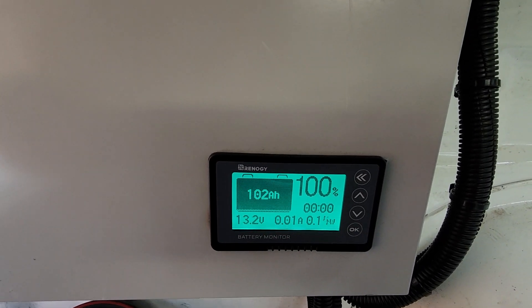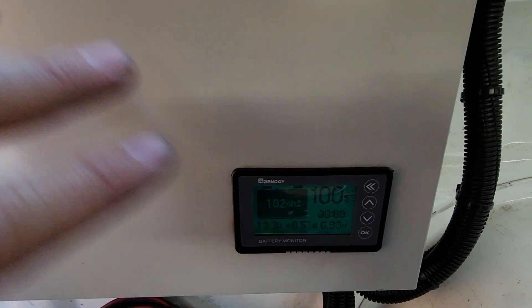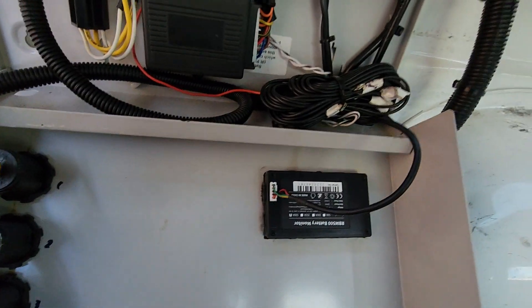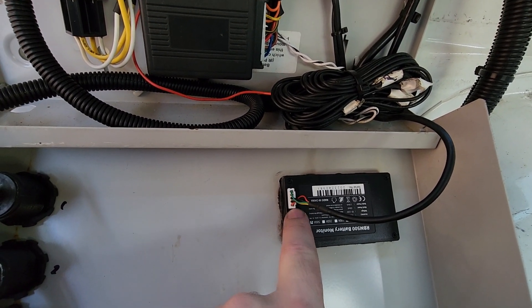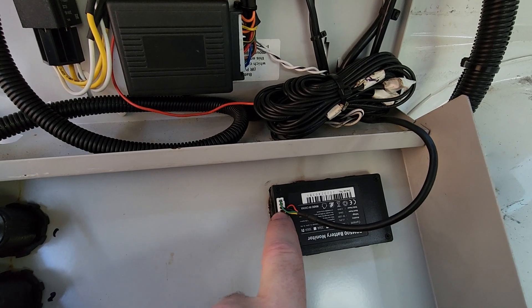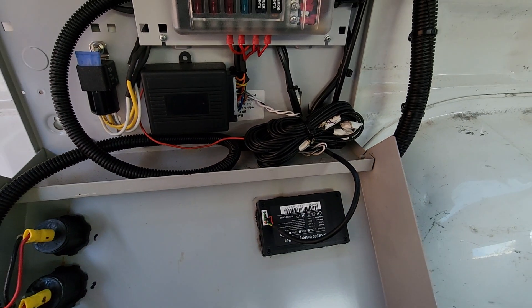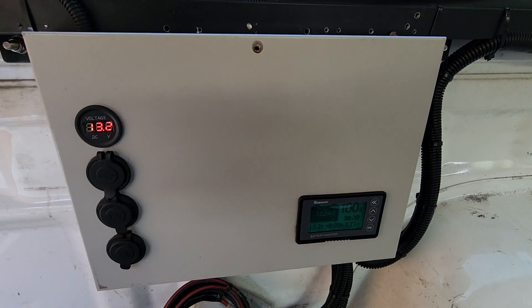It's a pretty solid system and I'd definitely recommend it. Before getting into what's under the hood, I want to quickly show you something. This already has a shielded cable — it's a six-metre cable, which is barely long enough for where I've installed this. Because it has this plug on the end, it can be quite difficult to pass through grommets. Be aware that if you're drilling holes to fit this, you need to be able to fit this connector without damaging it — including if you have to pass it through your vehicle's firewall.